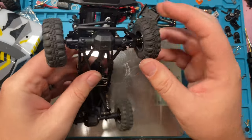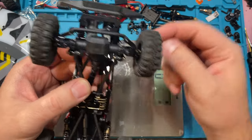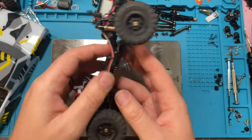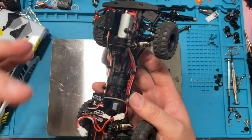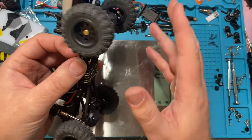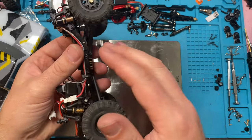So putting heavy weight in your wheels, getting brass wheels, putting brass on the inside of the wheels, and putting lead around the wheel, you can do all those things. It's just going to make it really heavy on your rotating mass, which is not good for your transmission, your bearings, or in this case, bushings, your motor, your ESC even. It'll all get hotter, burn out easier. It's also just not the best from a performance standpoint. And then you want it all unsprung, right?